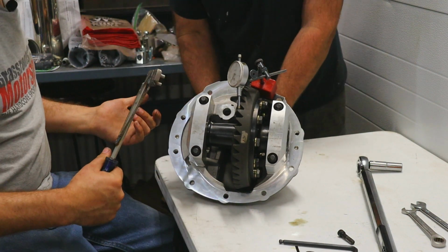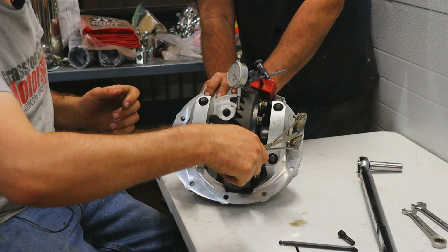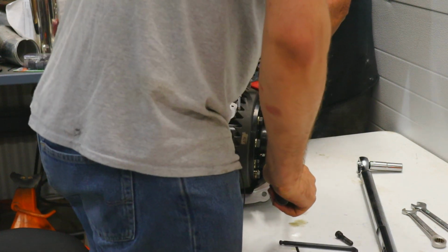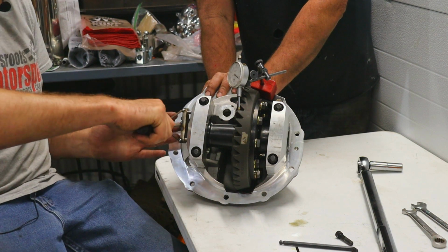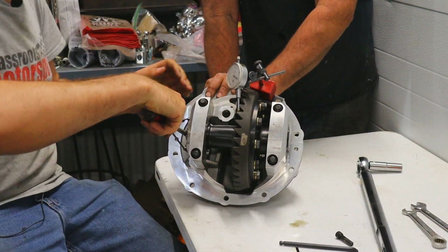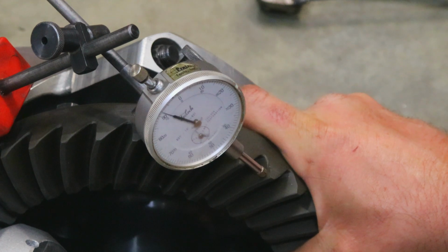Okay, so I'm gonna try to basically loosen up the gear. So to loosen the gear, you want to move it this way. So we need to loosen the nut on this side and tighten the nut on this side. You can show the wrench too. Oh, that's too much. There you go. So my dad made this little wrench, which basically engages with these nuts and allows you to change the nut position. Alright, that was probably too much, but we're about to find out. Perfect.